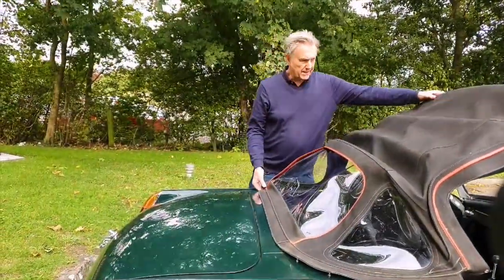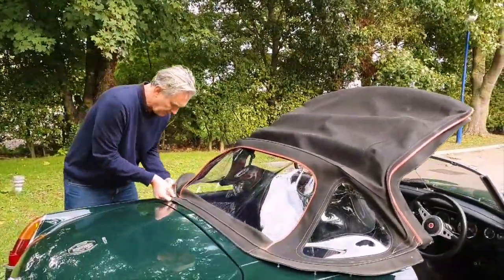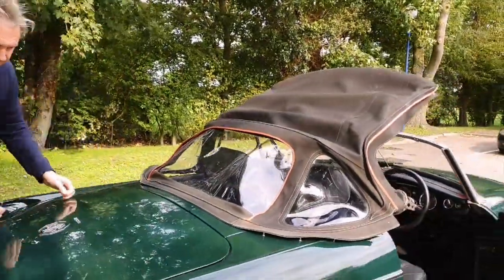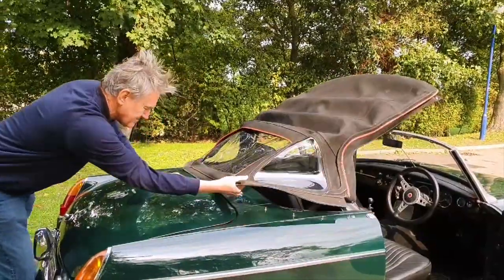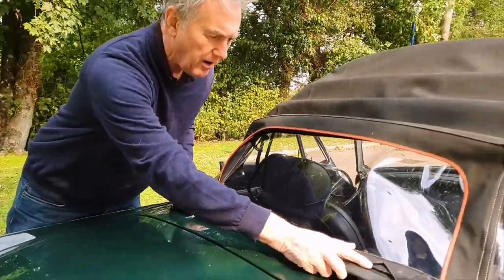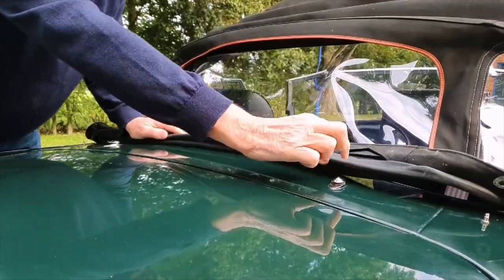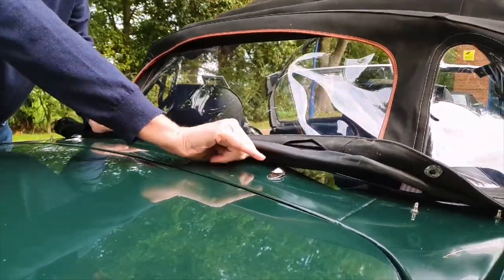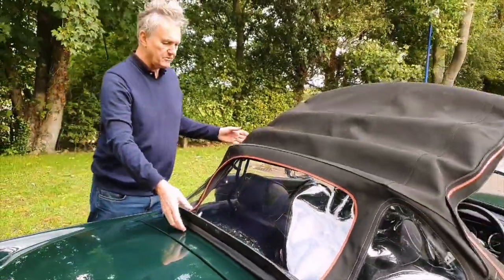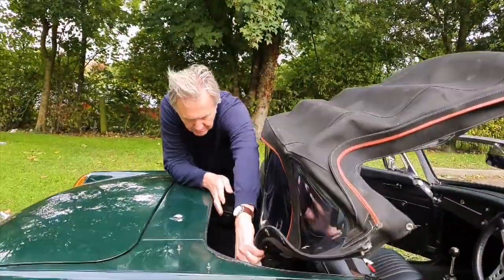Having freed those up, we can now lift the hood frame up a little bit more and then release the back bar. The back bar is normally held in quite securely. I'll show you where they're clipping on — there's a back bar in the hood here and here. These hooks are actually called teardrops because of their shape, so the back bar just literally folds into there to clip it in place. Remove that and it's free.